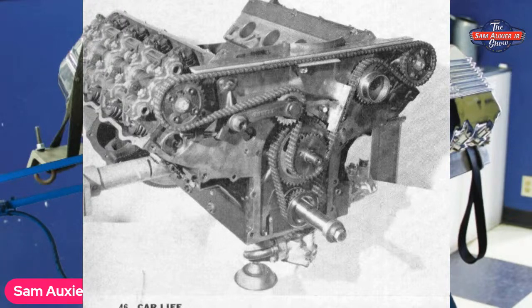The actual wave that everyone talks about, retarding or advancing the cams, comes in up here at the top, and that's what creates the craziness between the right and the left cam. But reality was, you're really talking about probably 5 degrees difference on them, which is enough to make it not like it. But back in the day, that's what we did.